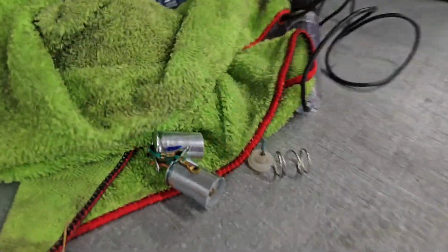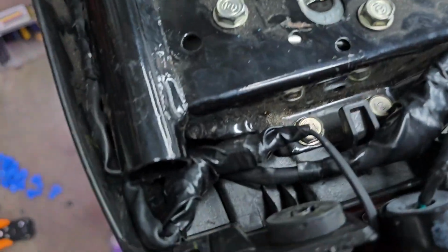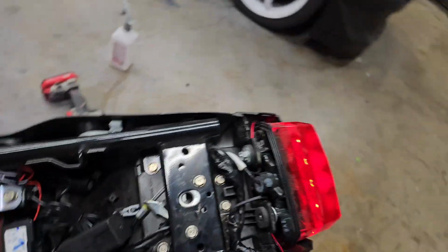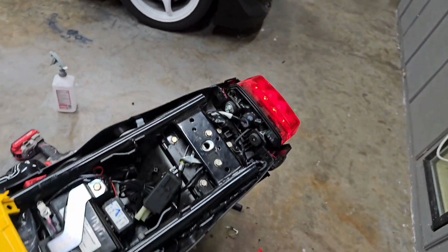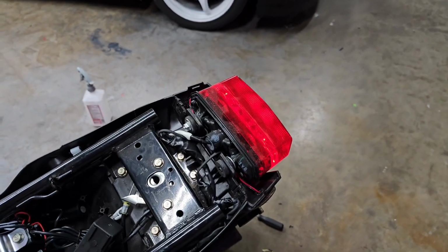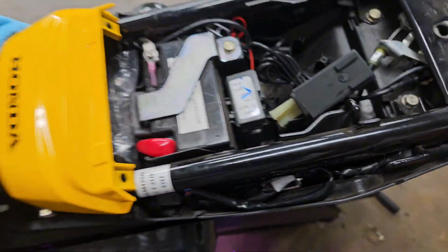and cut the bulb housing out, and I used some connectors here, stripped them and connected them to the source. Light blue is for the right side, and the other color, whichever color that was, is for the left. And I wrapped them with electrical tape, as you can see, and routed it along the side and connected it.